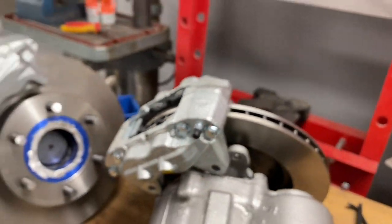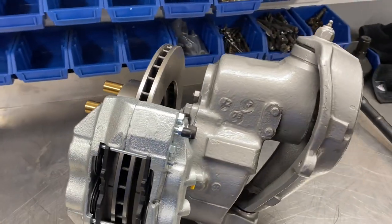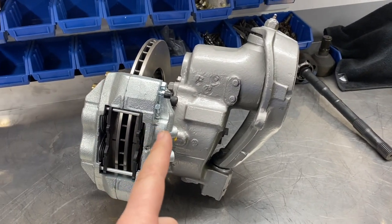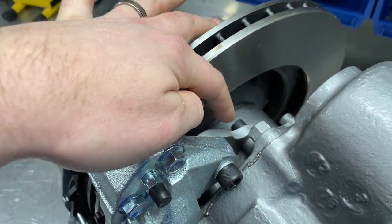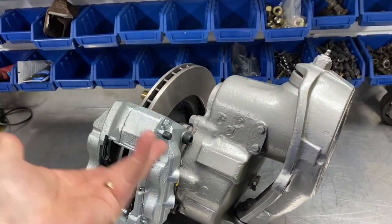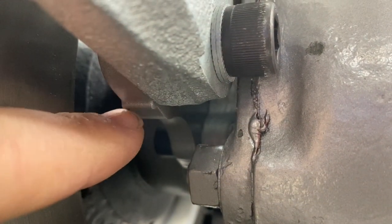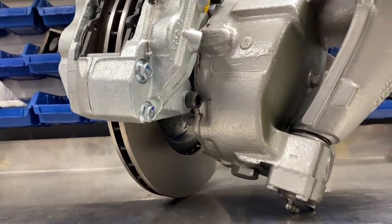On this one it's a bolt-on. Here it is, fully assembled. This is the left side knuckle — here's the axle tube and everything goes on in that direction. One thing to mention: on the brake caliper bracket there's a small edge, because the bracket is not mirrored in its design, so you can't put it on incorrectly. That small edge should be pointing down to the ground. Keep that in mind.